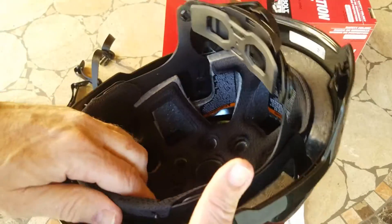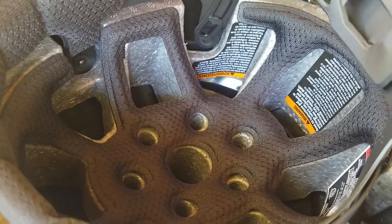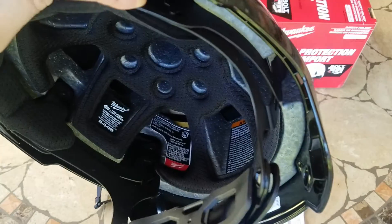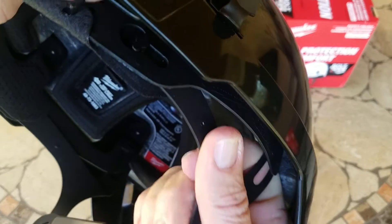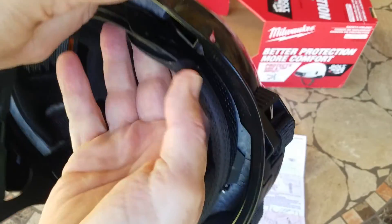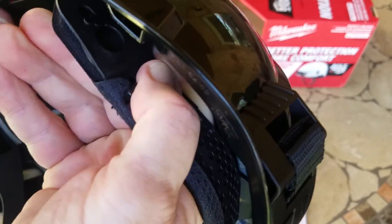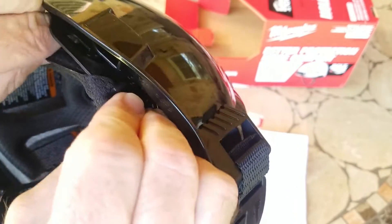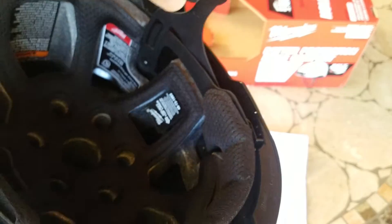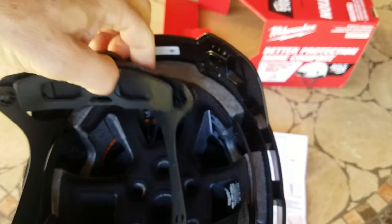This whole other mechanism comes apart. If you see here, it's slotted but that little tab has to go in another direction, and to do that you have to take this tab out first. You see it's slotted — it has to go in another direction. So you want to hold this here, see this little slot — push it forward and turn it a bit, pops out. Then we can get the back one out because we can turn it now. Zoom the link forward, pops out. There you go, so you can take all that out.